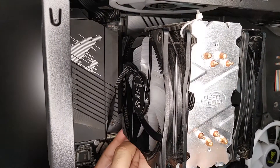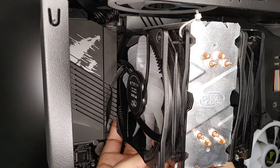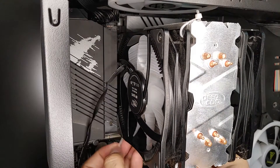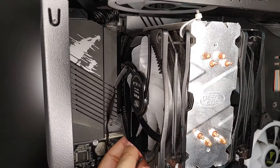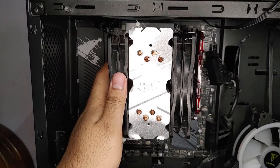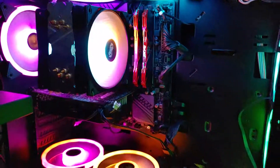The configuration of the fans should be pull and push — the front one pulling air in and the back one pushing air out, so more airflow passes through the CPU cooler. If you have a similar CPU heatsink and extra fans lying around, you can definitely add zip ties and increase the performance of your cooler. As you can see, it's sturdily fixed and not moving around. The motherboard provides additional power supply headers, so I've attached both fans.